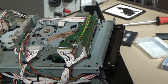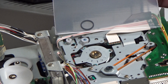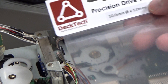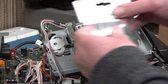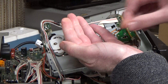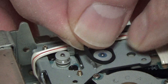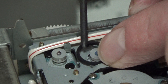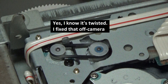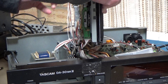I had to order a belt because as expected I didn't have any anywhere near small enough. A bit of web searching suggested the right size was 10mm, so I ordered a 10mm belt — though to be honest it looks too small to me. Let's try and put it on anyway. There is the belt — see if it'll go on. There we are. Now let's reassemble. There are a couple of other belts in here but fortunately both of those look okay.